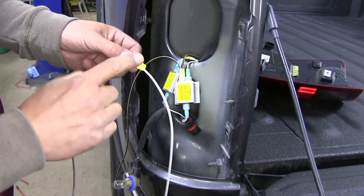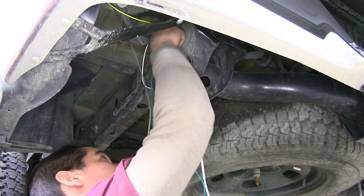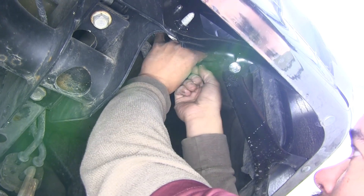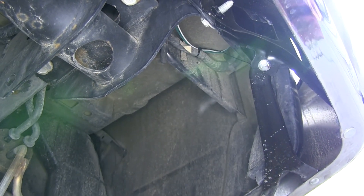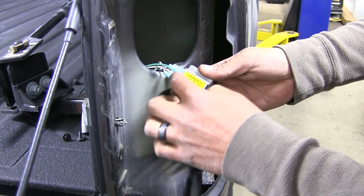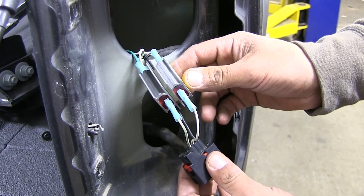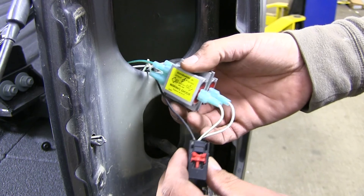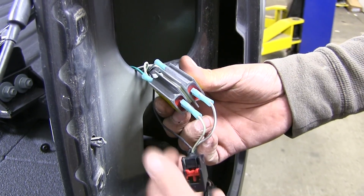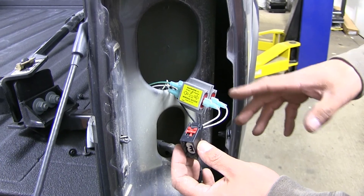We can pass this wire down and meet up with our green wire, then take our two remaining wires and pass them over to the passenger side, bringing them up through the taillight opening just like we did on the driver's side. Once you know you can reach each side, make sure you secure any excess or loose wires underneath the vehicle as well as up top. On the passenger side we did the same thing — wiring up our diodes the same way for each function: our turn signal and our taillights. On the back of the diodes there's a protective strip with some double-sided foam tape, and just to keep everything neat I attached my two diodes together so everything is nice behind the taillight.